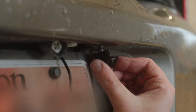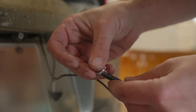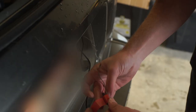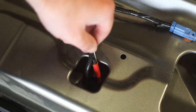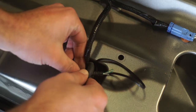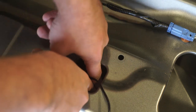Pop off the bulb housing from the connector, then thread the camera's cabling through the newly drilled hole and pull the wire through all the way. Feed the washer, lock washer, and nut onto the cable. I used a bent coat hanger to fish the camera's wiring through to the interior side of the tailgate. A small hole was cut in the grommet next to the adjacent wiring harness for the new cable.